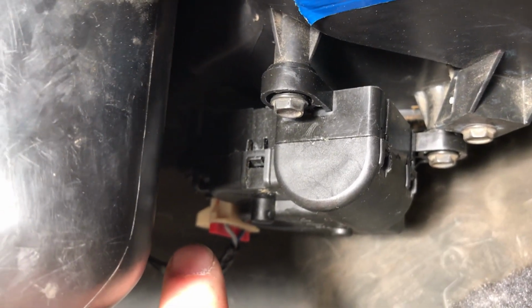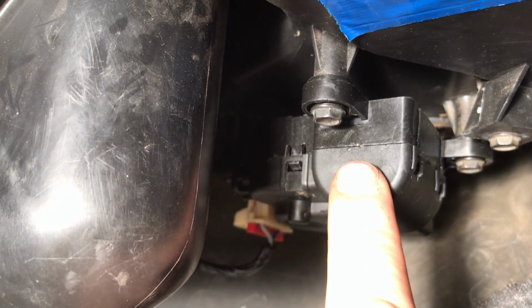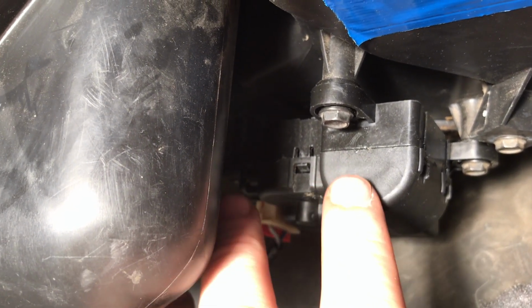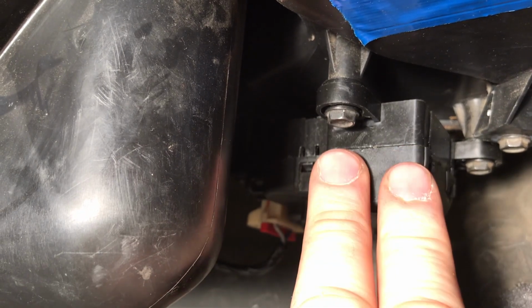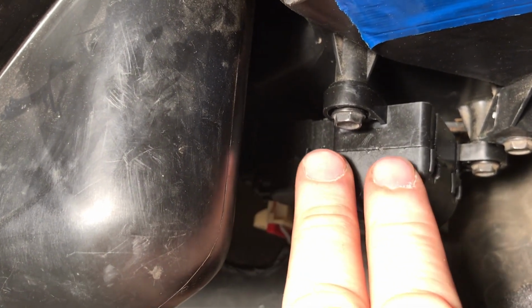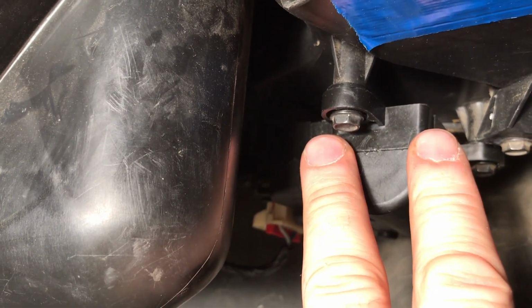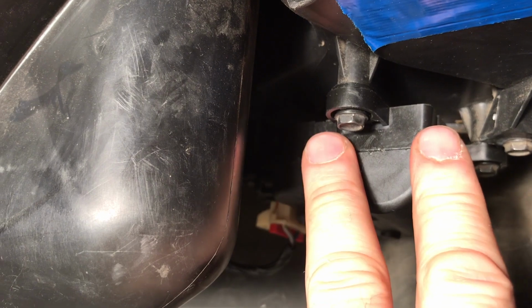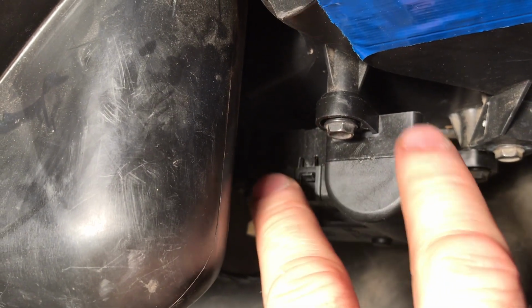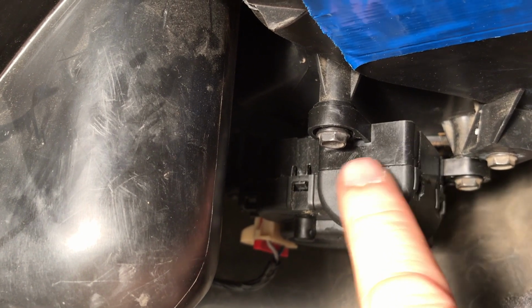Once you put that electrical in, you have your blend door actuator motor assembly put back into place. Your heat should be able to adjust from high to low now, and so you can adjust your cold and warm temperatures. Also, this is just a quick fix. Your gear may be stripped all the way and you might not be able to do this. I'm going to see if I can find a gear actually, because that gear would be a lot cheaper to replace than the whole thing.